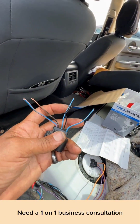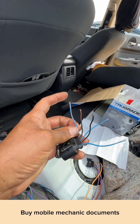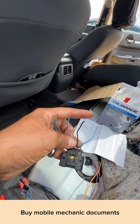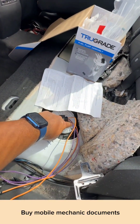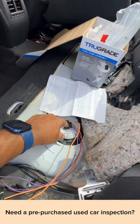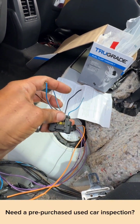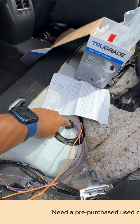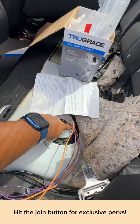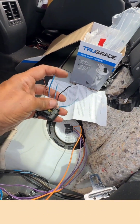So you're going to have the two purple wires — one right here. You're going to have orange here, orange here, and then a purple one, purple one closest to the edge of the plug which is going to be towards the driver side. Then you have this purple one which is the black one — they put it beside the power one. So now they separated the power orange and the ground orange with a purple wire in the middle.